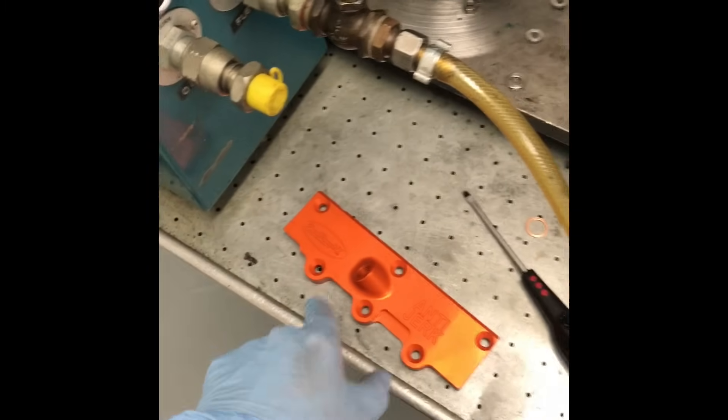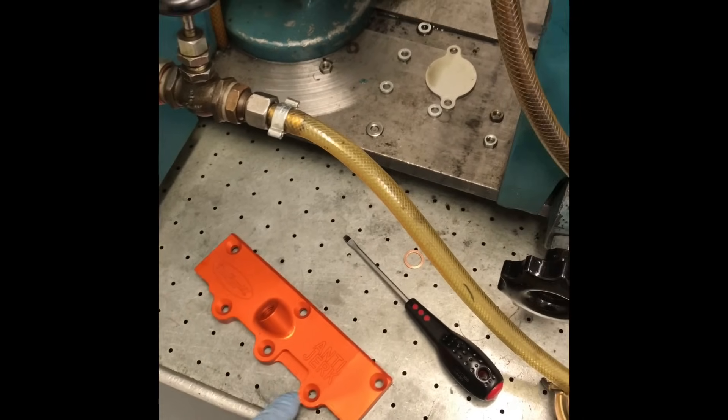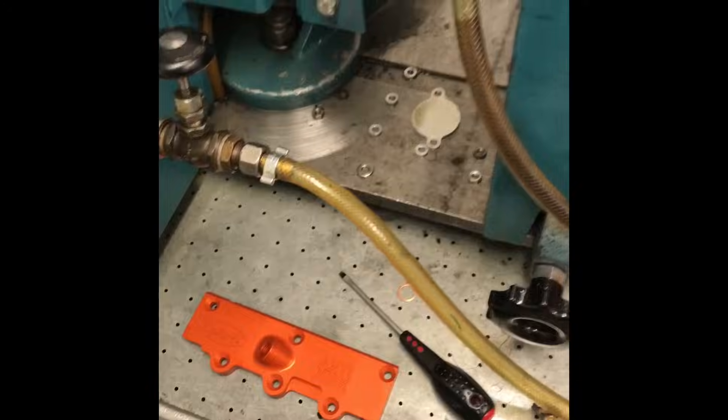Now there is another great aspect to this: this side plate also fits on the EDC pumps. There is talk of the EDC pump needing an anti-jerk system because that's jerking really badly too — surprise, surprise. So this will fit onto that as well. I haven't tested it on that yet so it's a little experimental, but I don't see why it shouldn't work any differently. There was also talk of potentially fitting a slightly stronger spring in the rack of the EDC pumps, but apparently that may get the electronic solenoid in the governor too warm. Well, with the extra oil that this is going to inject, hopefully that will help it cool as well. So there's lots of strings to its bow.